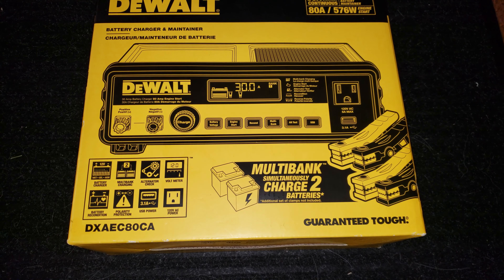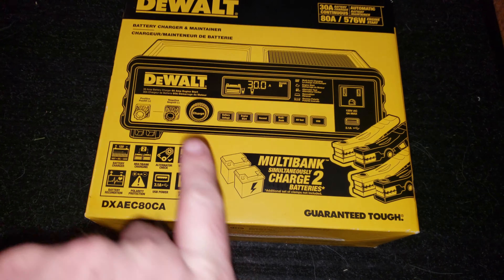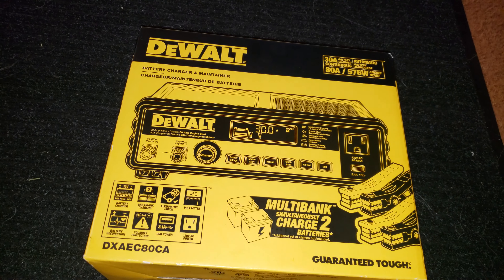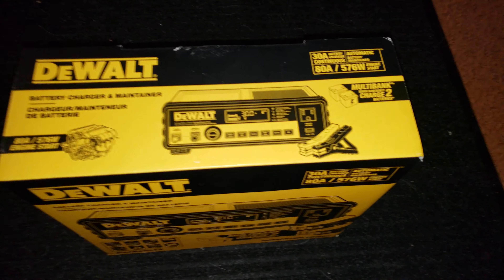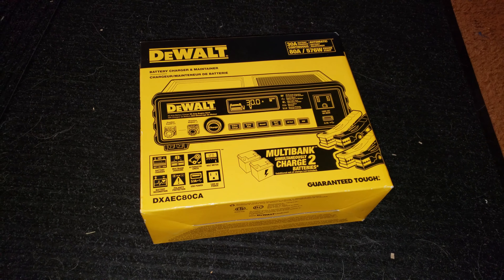I really don't need to ever do 6 volt, but one thing I notice: it says 30 amp and 80 amp. There's no slow charge listed, but it does say battery conditioning and recondition, so it has to go down to 2 amp somewhere — I just don't see it written on the box. Also, if you're doing the multi-bank using the front and the built-in connection, you're only going to be charging at 30 amps for both of them combined, so 15 for each.